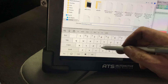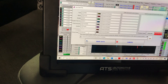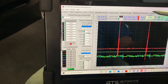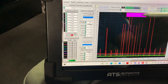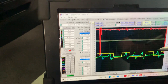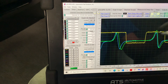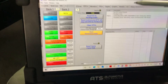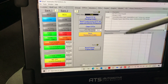07 Ford. Save that. You guys can clearly see we're way out of time. Now I'm just going to grab a normal capture while it's all smooth and we'll zoom in on 720 again, and you can see my timing. It's pretty good — looking good here, lining up good. Just a little off on anything. It looks real good, looks fine. The main thing I was wanting to show is that new feature from e-scope to be able to stop your scope recording once the code sets. Pretty cool feature.